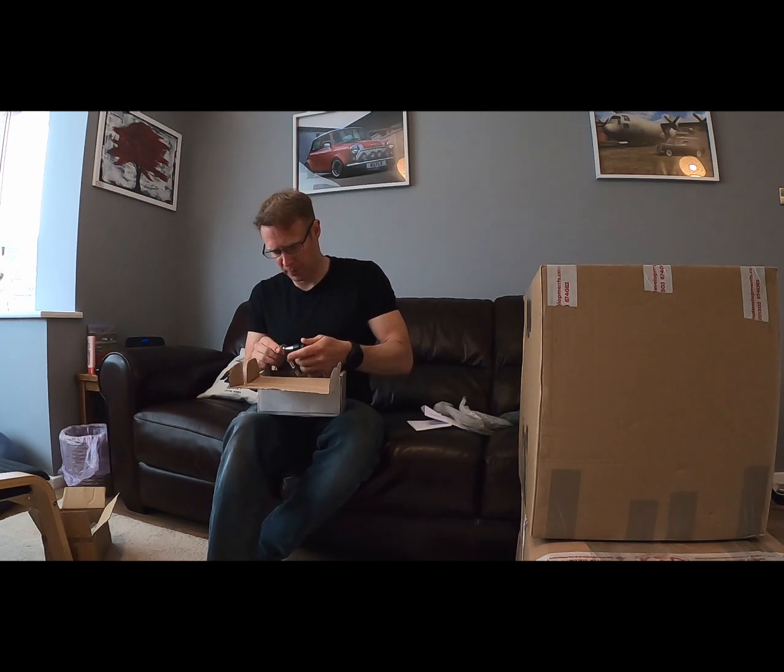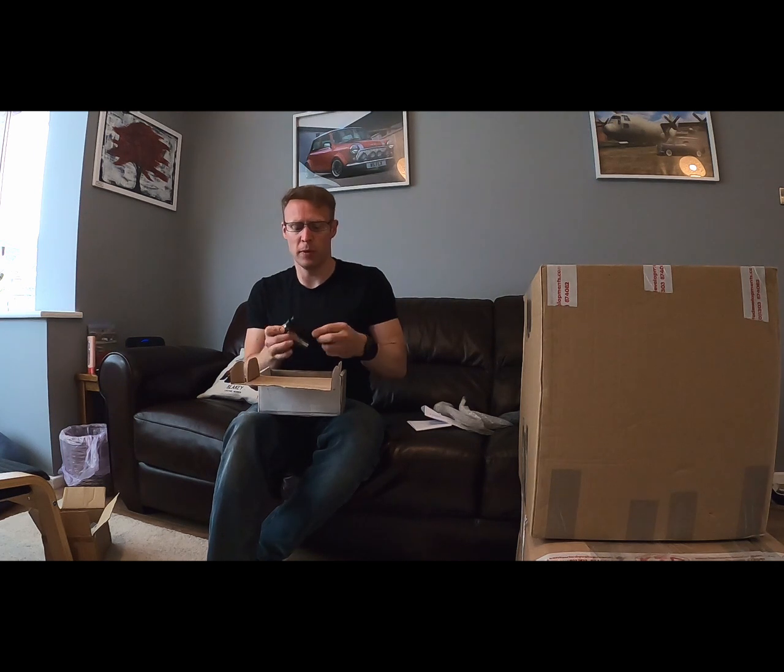So, what are they? Mondo Sport do steering arms. These are solid steel steering arms. The standard ones on the Mini are really terrible. If you have a knock, they bend, that's when your steering stops going all the way out. So this kind of eliminates that.